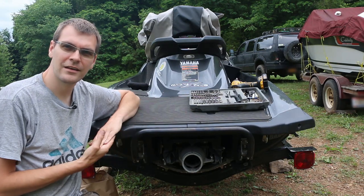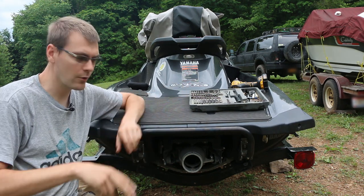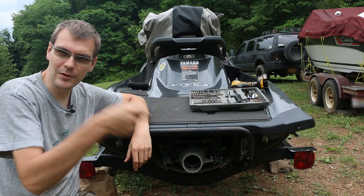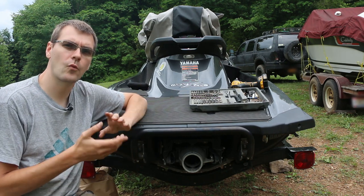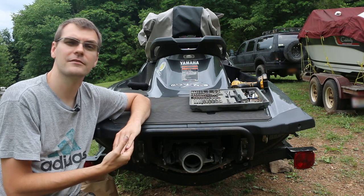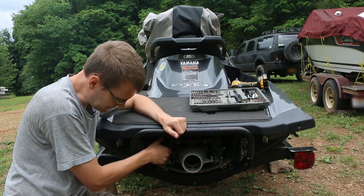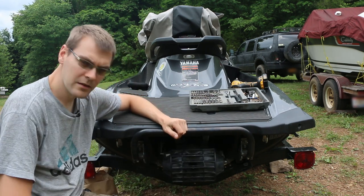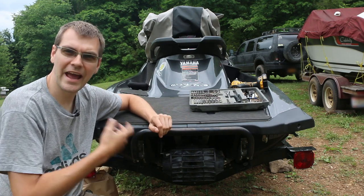So we're here today with this 2017 Yamaha VX. It has the RIDE system, which is the on-command reverse, neutral, forward right at your fingertips. It's a really neat system, but when something goes wrong with it, it can be a bit of a chore to fix, unlike the old cable-style reverses where you just replace the cable. We've narrowed this one down — it's throwing a code 159, which normally indicates that the reverse bucket is obstructed. But we've determined the reverse bucket is not obstructed. In fact, it moves quite freely. If I remove the ball off of the socket, I can move the reverse bucket up and down easily with one finger. So whatever is going on is something inside the motor. The fuses are all good, the relay's working properly — basically it has to be in the RIDE motor.